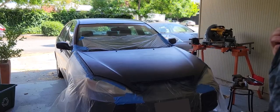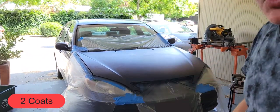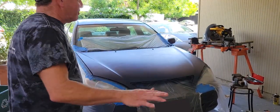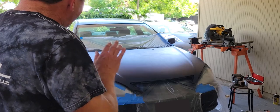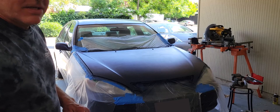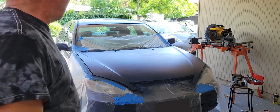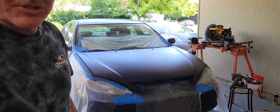Here's the deal: I added another coat and sanded it down with 2,000-grit sandpaper — you basically need a quarter sheet to sand the car twice, it's almost rubbing it with nothing. Then I painted it again and rubbed it down one more time. It looks great but just looks dull, so I'm really hoping the clear coat gives it that wet look, because when I washed it down and it was wet, it looked phenomenal. Let's give it a shot.